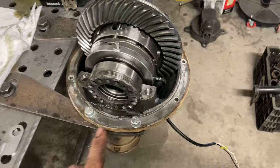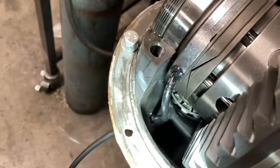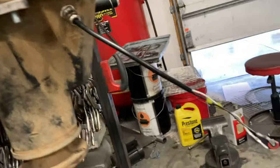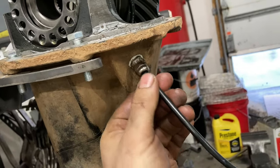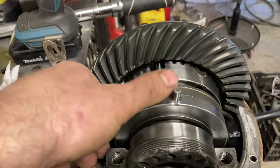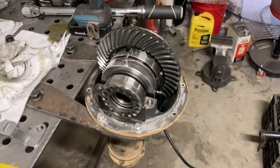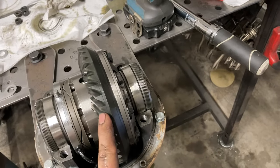You can see there's only about two inches of wire inside the case before it goes through the pass-through. Once fully assembled, I'll tighten this gland nut down to compress the rubber around the wire and seal off the junction. With that post standing straight up, the wire output sits at roughly the 12 o'clock position as it sits in the car. Going to get the caps loosely installed and then show how to set up the bearings to get the proper backlash.